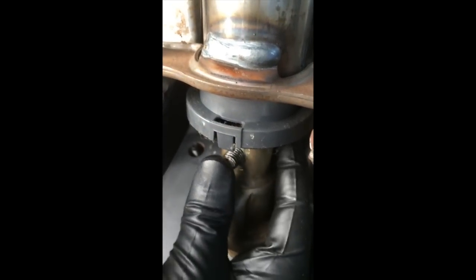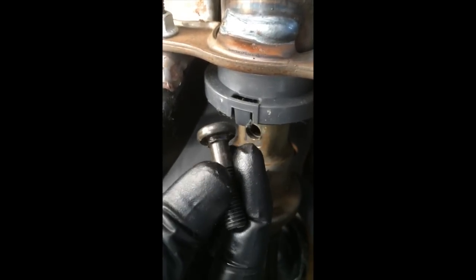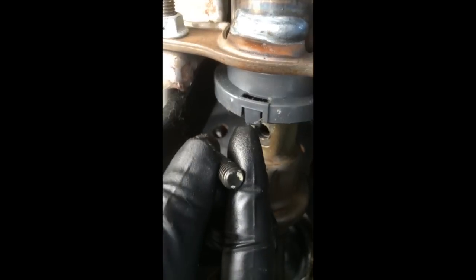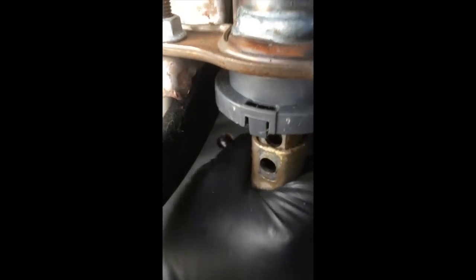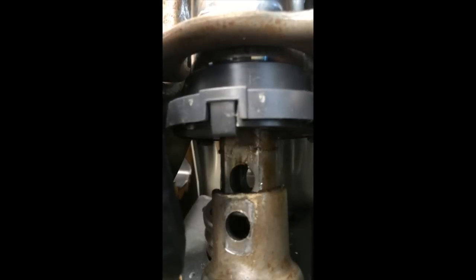You just need a socket — it's not going to turn on top. I'm going to push the bolt up through the steering coupler. It's a flathead, secured at the base of the neck, squared off, so all you need is a socket to get the nut off. Once this is off, we're going to push the steering column back into the firewall, and then we'll be able to get access to the bearing sitting inside here.